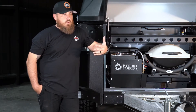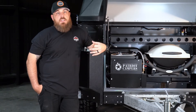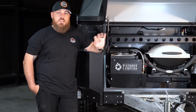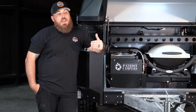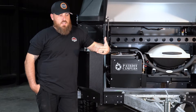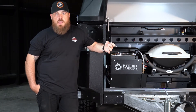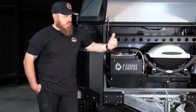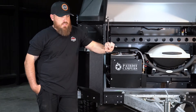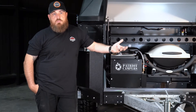The first thing we want to cover is your Webasto smoking — gray smoke coming out of the exhaust — or you're turning it on and it attempts to start, runs for a couple of minutes, then turns itself off and you don't get any heat. The reason the unit would turn on, act like it's going to work, and then shut off is it's built up carbon on the burner. There's a titanium screen inside that burner — a real fine mesh — and the carbon particles build up on that and also in the exhaust. The unit reads the electrical resistance across that screen, and if the resistance is not in the correct parameters it turns off to prevent damage.